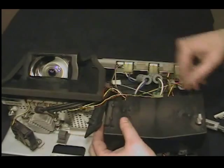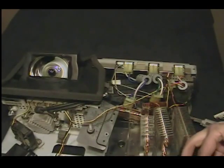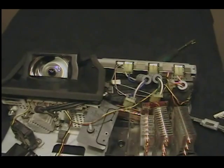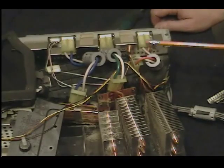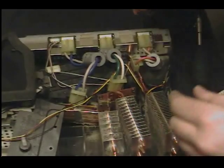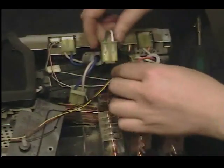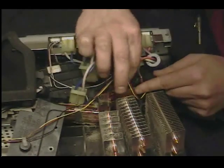I've got those bolts out. There's a little plate on top and this whole piece should just lift right off. Inside this fan I'm just going to tuck that over to the side. I've got another fan here and these cooling fins are what I was talking about. I noticed last time that the red one on the end was really dusty and dirty, so my theory is it wasn't cooling properly and that's what blew out the LED. I'm going to start by unplugging the red one — there are two cables per LED, a thicker one and a small plug.